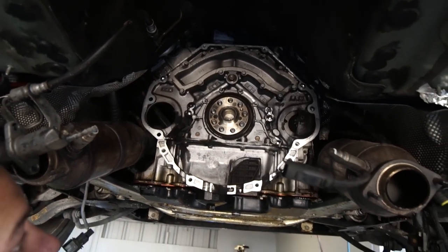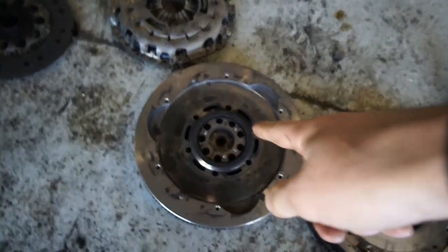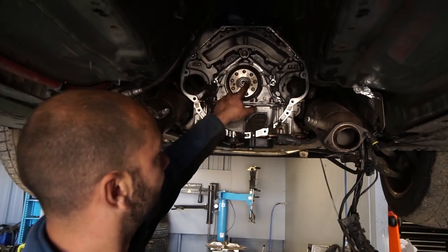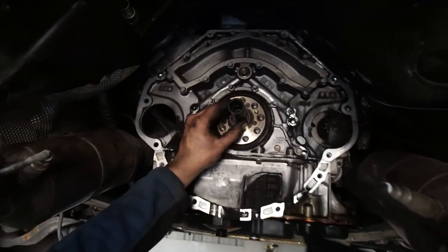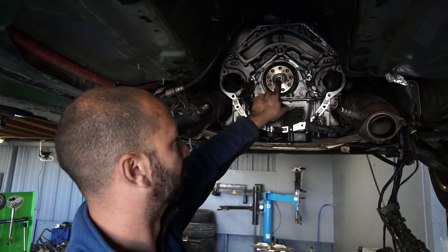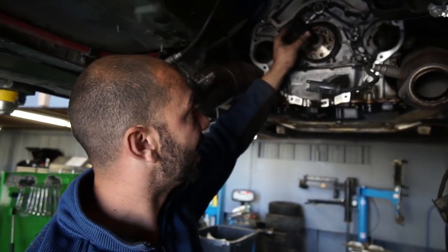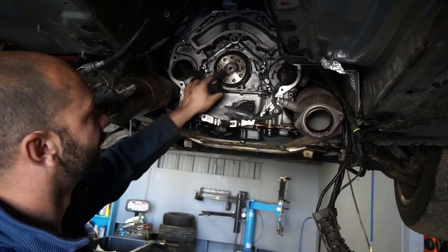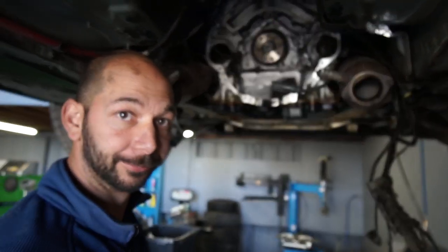The crank of this car still seems to have a provision for it, so I'm going to slap it in there and hope for the best — and my rear main seal isn't leaking. I went and snagged the pilot bearing out of the M5 crank and it fits in the N62 crank. A little heads up on installing pilot bearings: get a socket that is the size of the outer race of the bearing, that way when you pound it in you don't end up breaking the inside out. Pound it all the way in until it stops — don't just pound it flush.